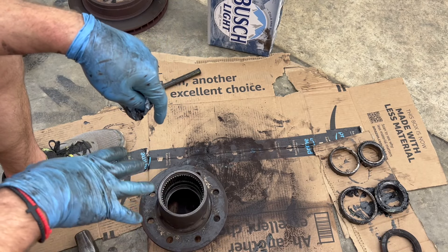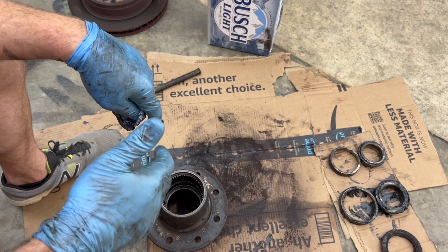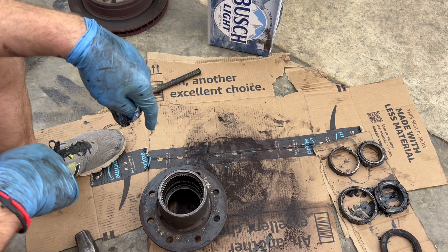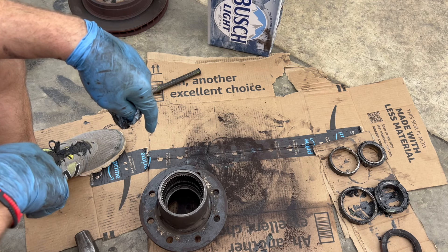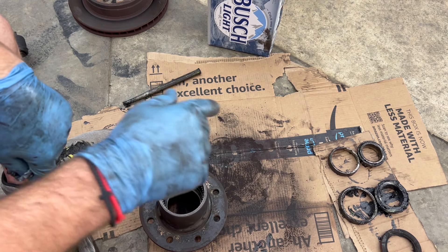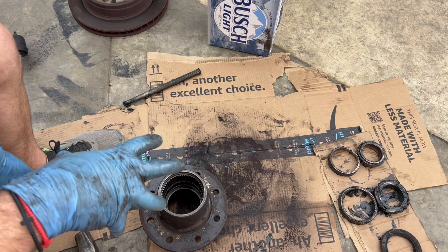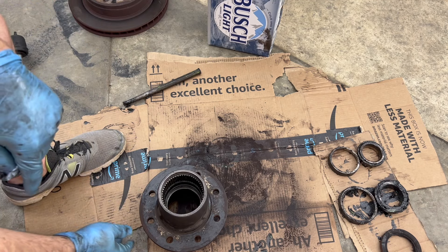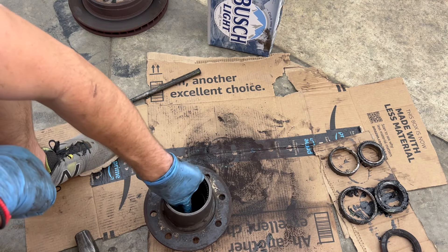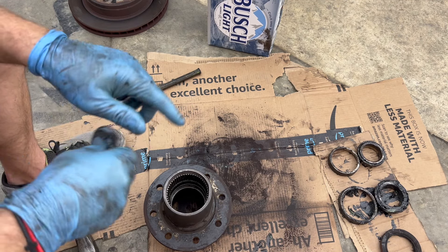One thing I should mention — you don't necessarily have to do your bearings if they're in good shape and you've got a good seal. The customer just wanted us to go ahead and do this because we're already going to have it off and separated from the rotor to do all this, so he said let's go ahead with new bearings and seals while we're doing the rotors and new brakes on the front. You can just knock out the studs like I did earlier and leave your bearings in there — I would recommend repacking and greasing them at least while you have them out. He also doesn't even remember when it was done last. Now we have this all cleaned up — it's very important that where your races go is nice and clean with no trash in there, because that could affect seating the race properly.